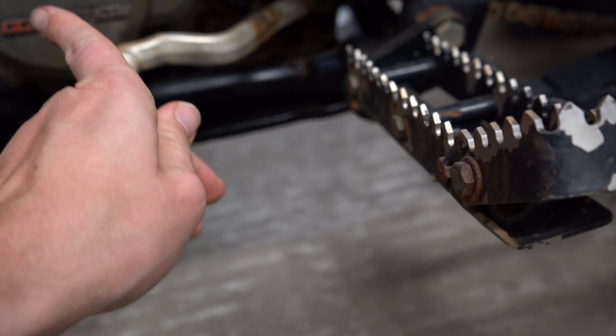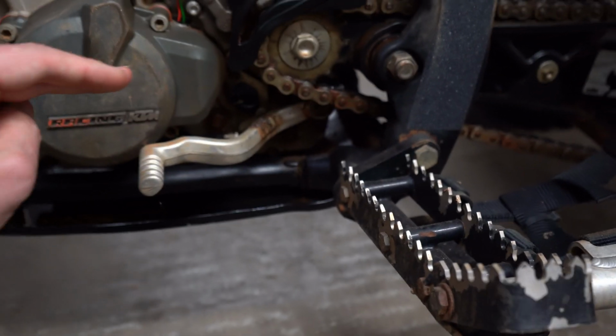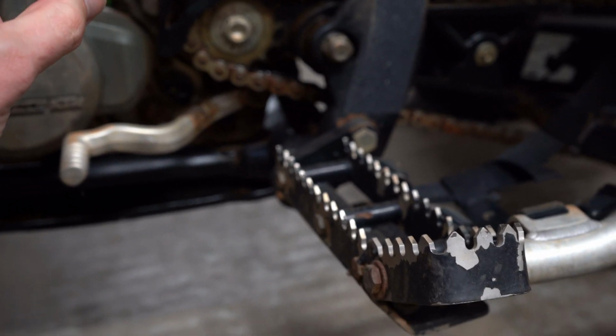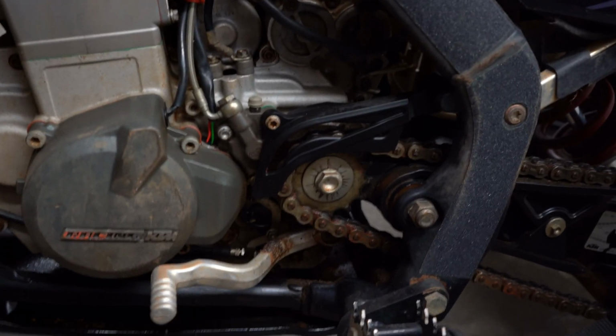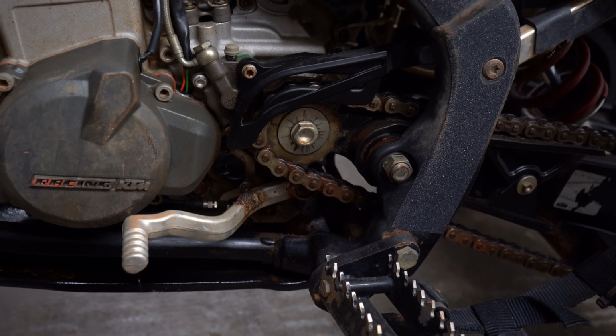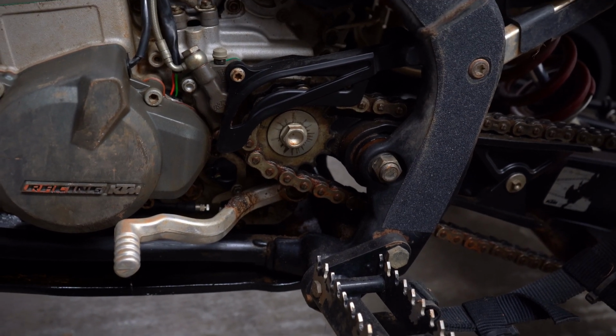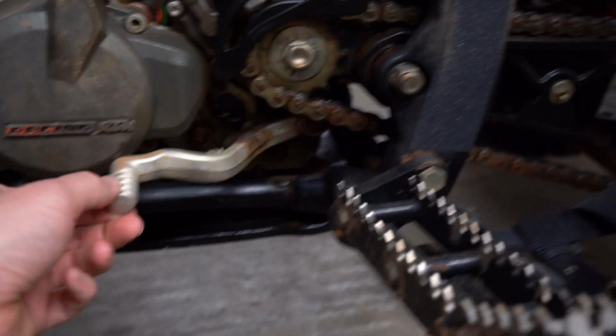And I want to say with the last time I took one out, it goes in 3 threads, and then it's got like a tunnel to the transmission. So it's got a big open spot in the threads, and then it picks up the threads later on. So the bolt's probably that long. It connects by 4 threads, and something about it, I don't know if it's the angle or the crush washer that's in it, but they just don't like to seal after many, many years of getting used. So that's unfortunate. It's got a leak.